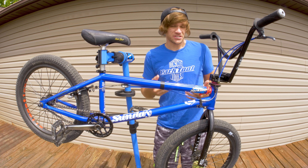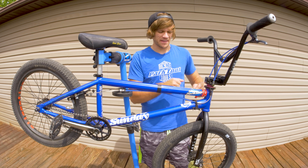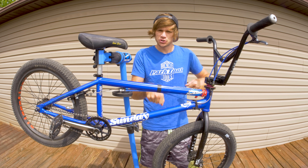With a shorter bike, the closer your wheels are together the more agile your bike is going to feel — when you turn, things happen faster. The opposite happens with a longer frame with a mellower head tube and fork offset. Trail-oriented frames also have a longer rear end to create a longer wheelbase so you feel more stable going through the trails. Having a more reactive, twitchy bike in the trails isn't something a lot of trail riders like — but that's personal preference, and plenty of people ride park or street geometry frames in the trails just fine.